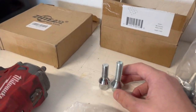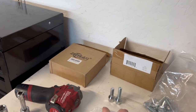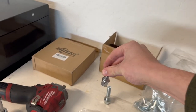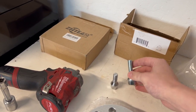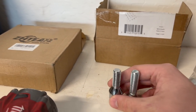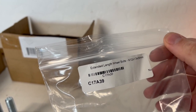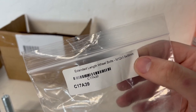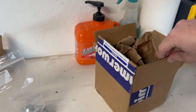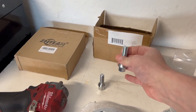One last item to mention: when you install spacers, the stock lug bolts now thread less into the hub of the car, so you also need longer wheel bolts. These are 39mm long, M12x1.5. I actually ordered these off of Bimmerworld — oddly enough — but they had a decent price and had exactly what I needed.